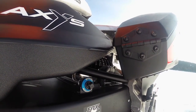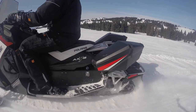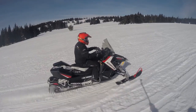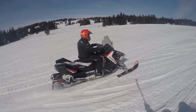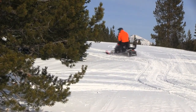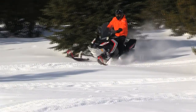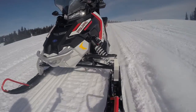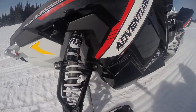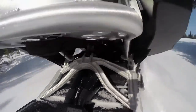It'll never be full of ice or snow. There's a nice little chart on the side of the tunnel, so depending on rider weight and all the gear and luggage you've got, it tells you exactly how much pressure to put into that shock. The hand pump is located conveniently underneath the storage rack in its own pouch — you just unzip it, take it out, unload the shock, lift the back end up to take the pressure off, screw in the pump, set it to how you want, and bingo. You can set this thing in two seconds, and it's got a nice convenient storage pouch underneath the machine.